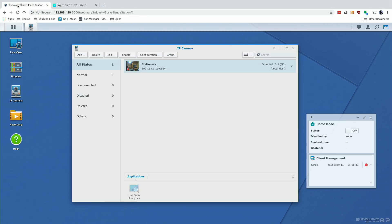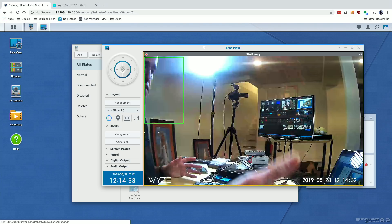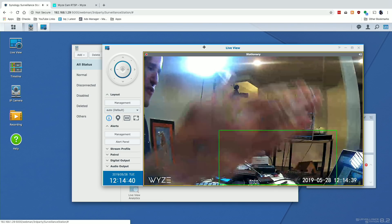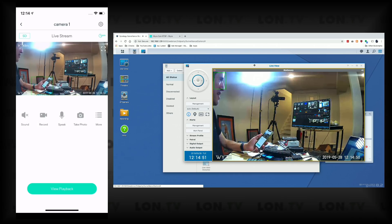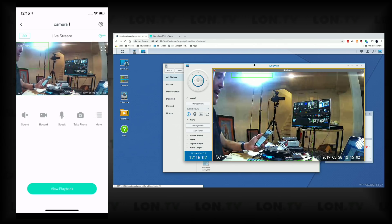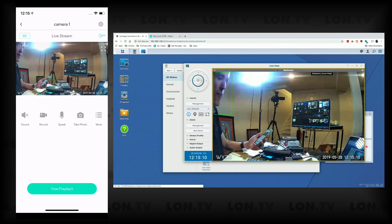Let's step through how it works with a third-party DVR solution. Right now we're on my Synology Surveillance Station homepage. If I go over here to Live View, we can pull up my camera — and there it is, it seems to be working just fine. I am noticing that there is a bit of latency in the time it takes for actions I do in front of the camera to show up versus the app. And I'm also finding that occasionally the RTSP server inside the camera will miss frames, so you're not going to get every frame. The video quality here doesn't look spectacular either, but it does seem to be good enough for what you might expect out of a $25 camera.